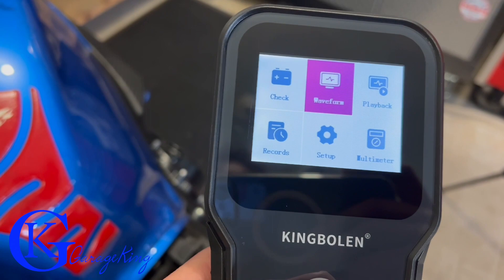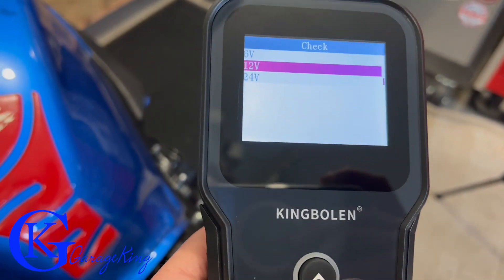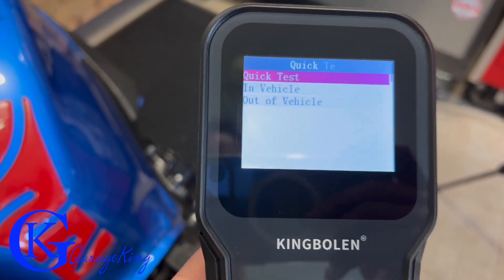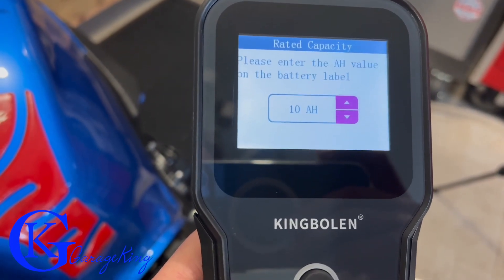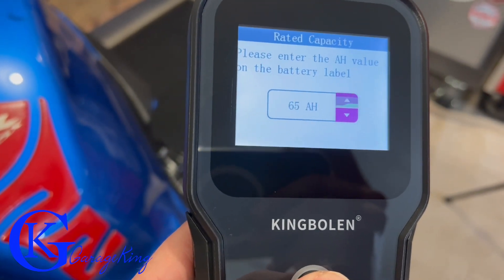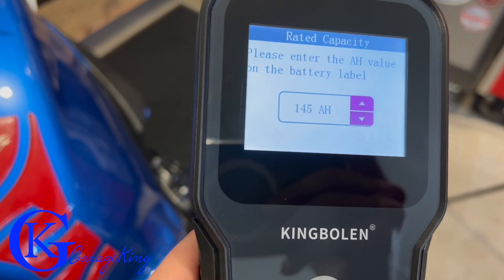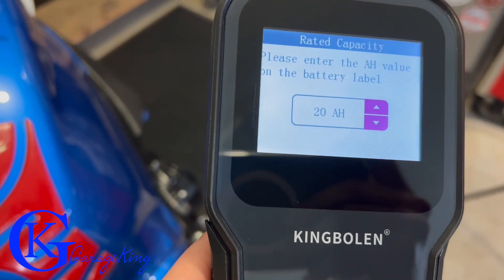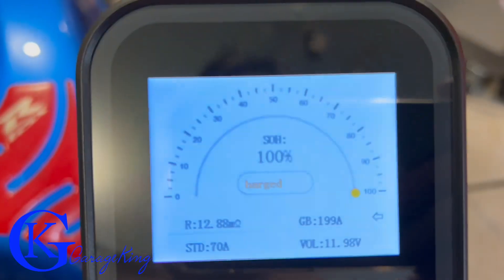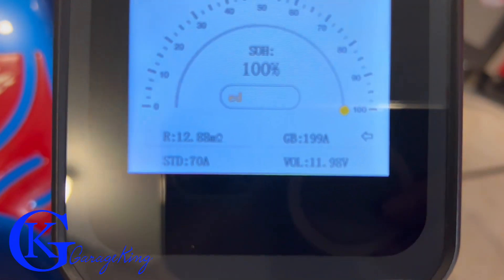Now let's go to the battery test. We're going to check our battery — this one is 12 volt. You have three options: 6 volt, 12 volt, and 24. We're going to do a quick test, which defaults to amp hours. The vehicle is off. This motorcycle has just a little 10 amp-hour battery, but you can crank it up to 220 amp hours max if you have a truck. We'll go back down to 10. You can see it is a little under 12 volts. The SOH — that is the battery life — is telling us our battery is good, but we should retest it after charging since we're under 12 volts.